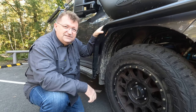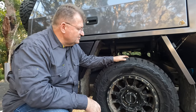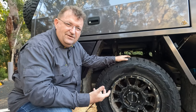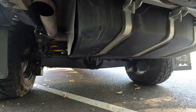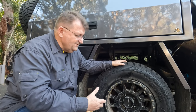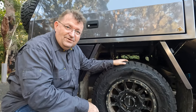At the rear, it's the same King Shocks three-inch suspension componentry. We needed a three-ton rating on the rear axle to achieve the 4,490 kilogram GVM. ASG 4x4, who built the vehicle, stiffened the rear axle with steel plating and really upgraded the strength of that rear axle. Combined with the suspension components, everything comes together to give us the weight rating we wanted from the vehicle.